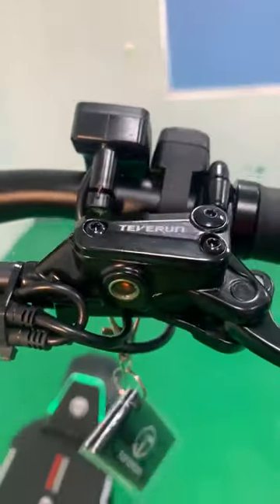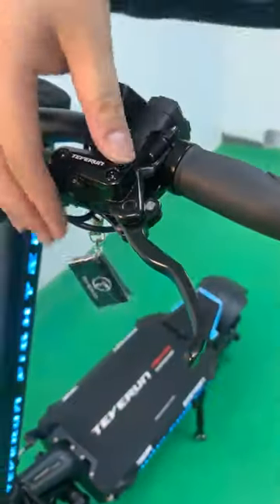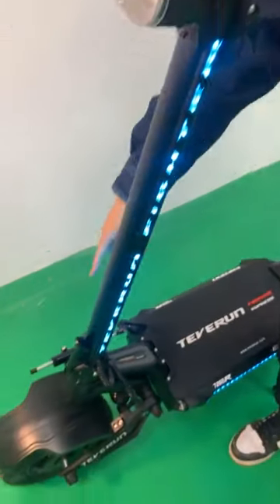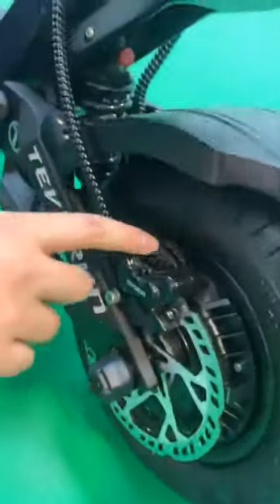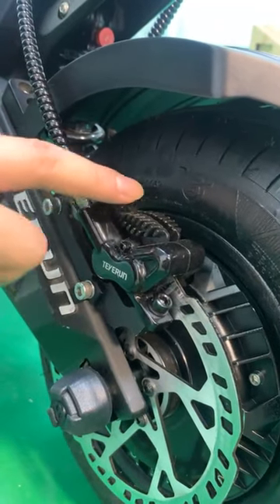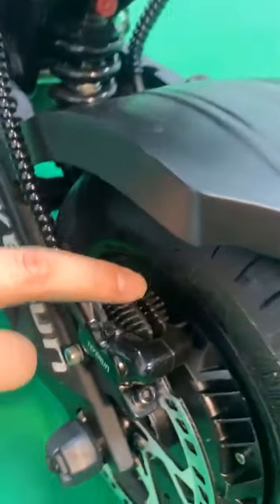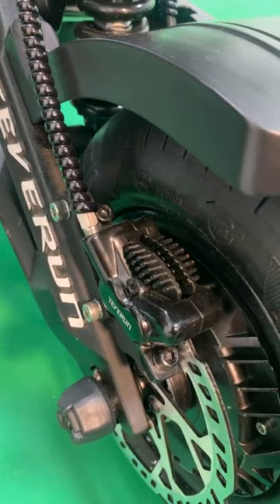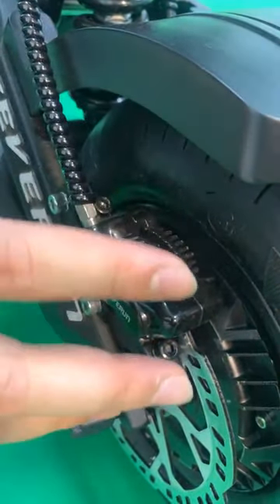You will know when you need to add oil to the reservoir. Furthermore, we have upgraded the brake caliper by adding cooling slots. This enhances the brake pad's service life by increasing contact between the brake pad and the air, resulting in more efficient cooling.